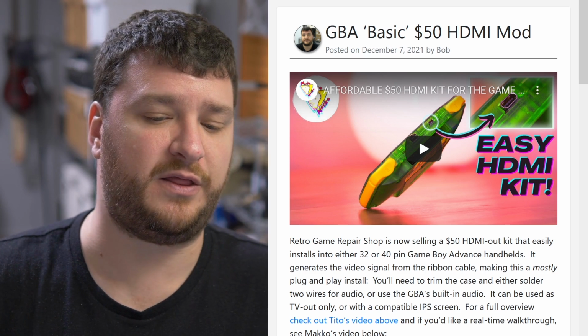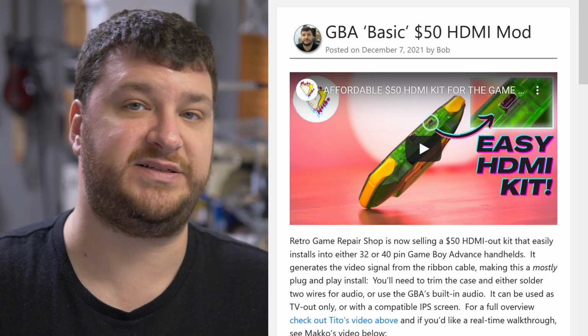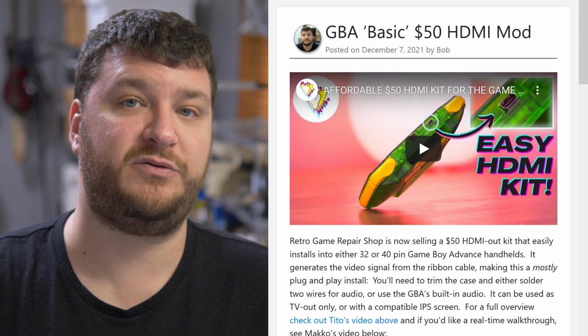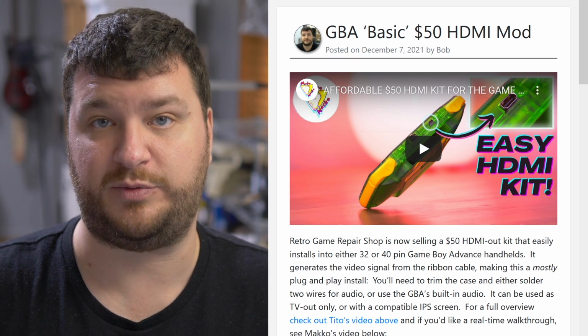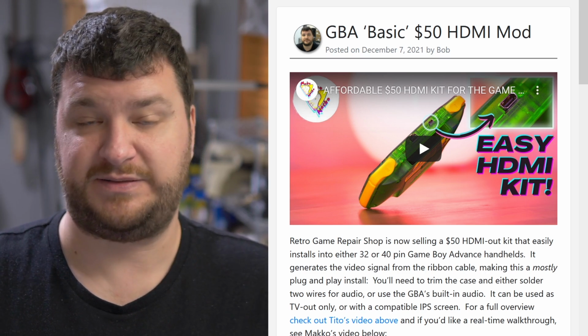You do need to cut the plastic to fit the HDMI jack, so you'll probably want to use an aftermarket case if you have a really nice condition original Game Boy Advance shell. And that's basically it. Now, the kit will not allow you to use your original screen, but there are some IPS screens that are compatible with it. So if you wanted to use that, you could have a dual purpose device, and that's basically it.